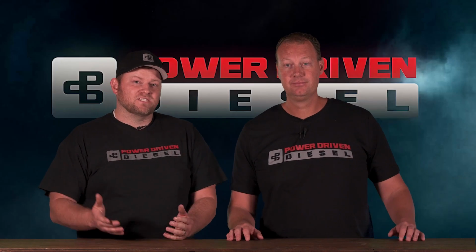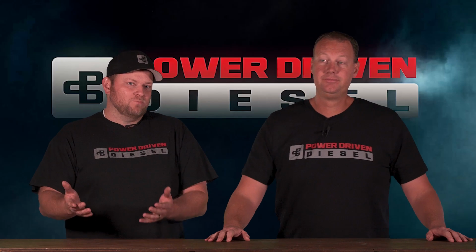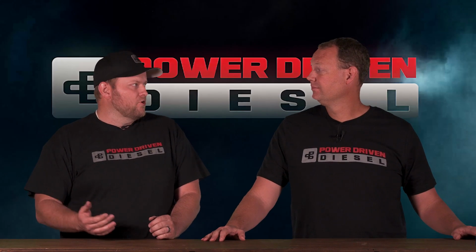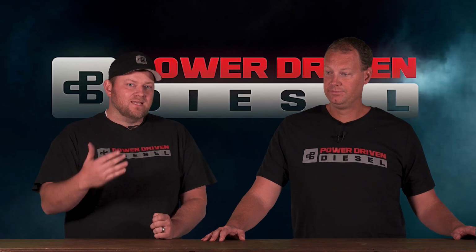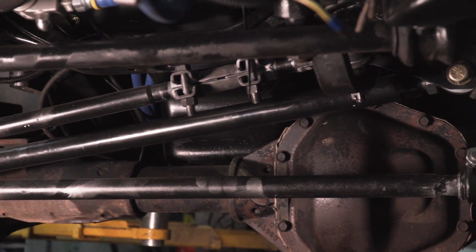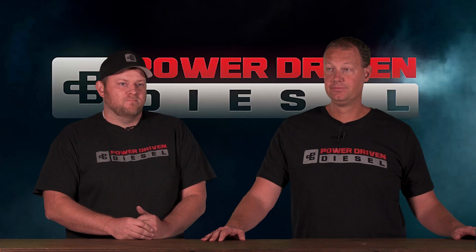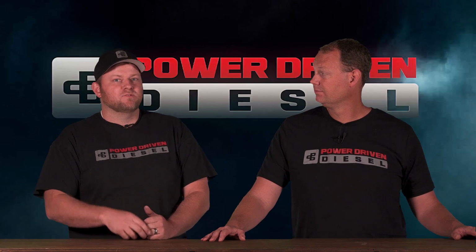Now, getting back to the suspension side, the other thing that really is a problem on these Dodges is the front steering wears out, and they don't handle well, and they get death wobble. This being a 96, it had the Y style steering, which is more prone to death wobble, especially if you launch really hard and the front end pops up. So we went to the 98 newer T style steering. Got all those components, just stuff from the local Napa, nothing special, but brand new components there. And going to the 98 style, the steering is gonna be rock solid.